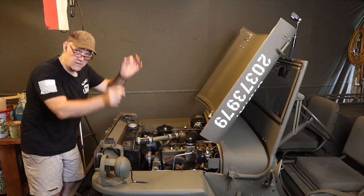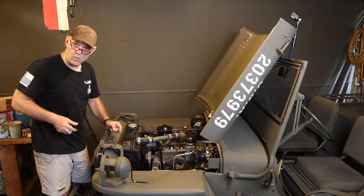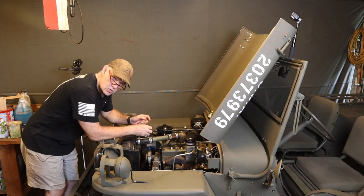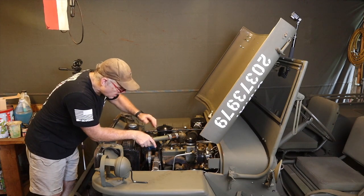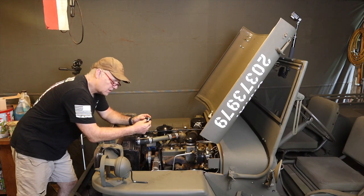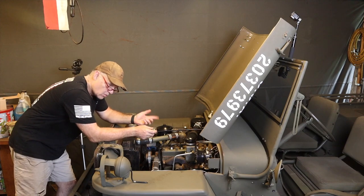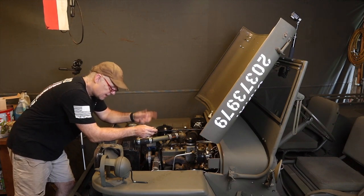Now the radiator is full of these little tubes going up and down and a bunch of fins, and we've got air blown from the fan through there. So that warmer water, it's now 160, starts draining down those tubes and in the process cooling off. And in the meantime, the reservoir at the bottom is getting pumped by the water pump in through the block, in through these various channels and absorbing the heat. And as the temperature rises, this thermostat will open up more and more and more until it's fully open. And at that point, you've got whatever amount of coolant circulating through the block as you have. And so if you're sitting at an idle and you watch the temperature increase, well, that's basically the thermostat is full open and it's circulating through.